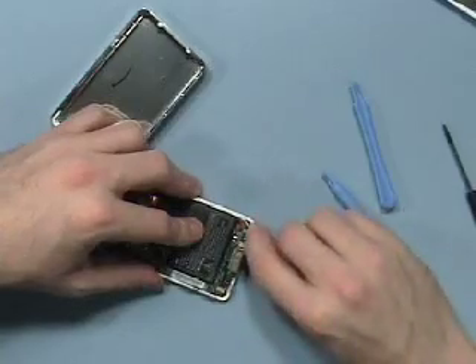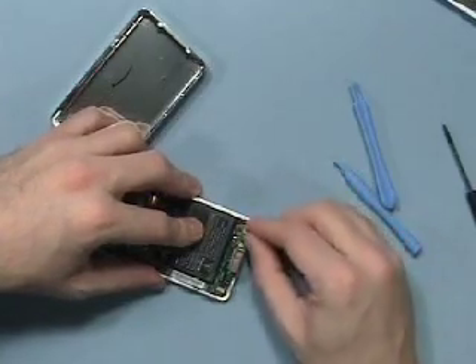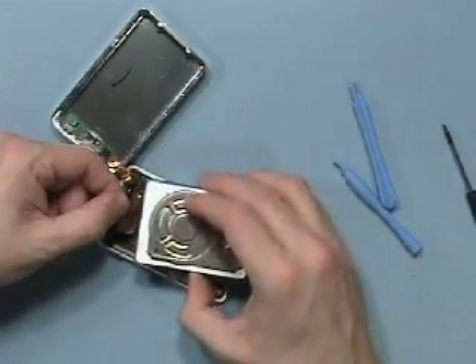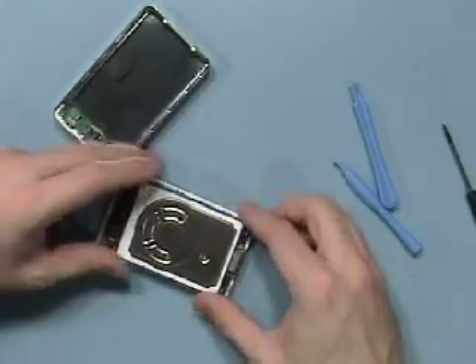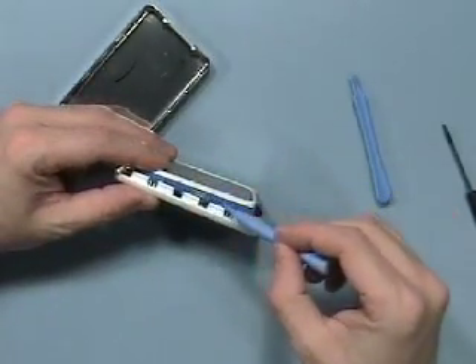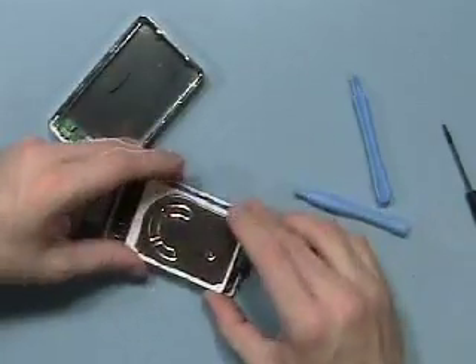Set the power connector back in and gently lay the wires down. Take the hard drive — there's actually a guide pin at the end. Set the guide pin in and it'll make sure you're perfectly lined up. The hard drive will then go right back in where it came from, and you'll notice on the sides that there are cutouts in the gasket to fit back down around the edges on both sides.